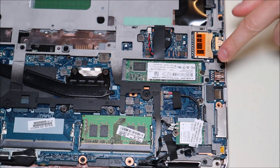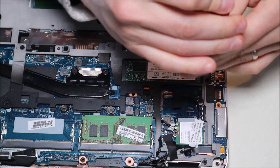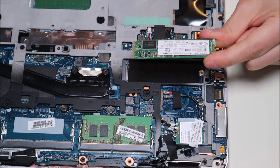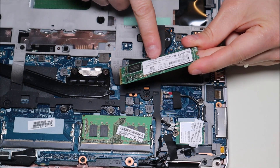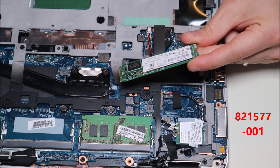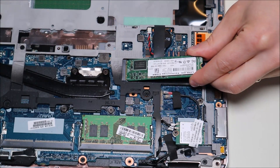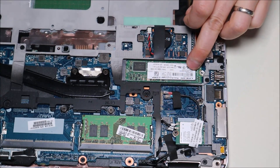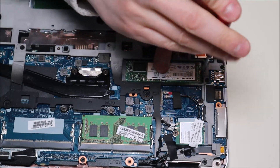There's your solid-state drive — as you can see it's held in by a single screw. I'll take that single screw out. Your solid-state drive pops up and then you pull it out of its port. There's a convenient sticker with the replacement part number: 821-577-001. To put the solid-state drive back in, you put it right inside its port, make sure it's flush and flat, then it goes down and you screw it back into place.